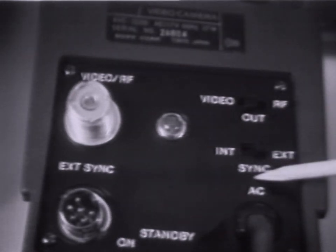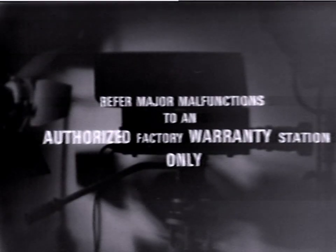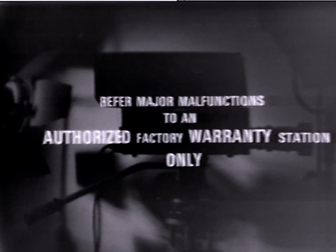Many video cameras may be connected by an external sync cable or RF coaxial cable — these function switches should also be checked for proper match. The monitor switch should match the input source: from the air, a video recorder, or a live camera. If the equipment still does not perform, a major malfunction may be indicated. If additional equipment is available, substitute other pieces of equipment into the non-functioning setup — first cables, then recorders, monitor, and camera. If the equipment still does not function, call your nearest factory authorized service representative. Do not attempt to work on the equipment yourself — it voids the warranty and can be dangerous.